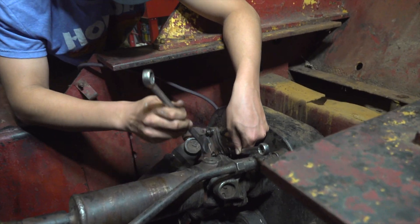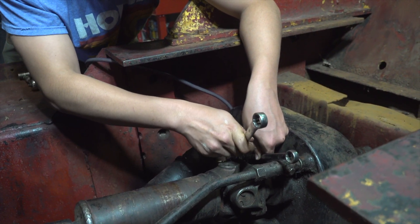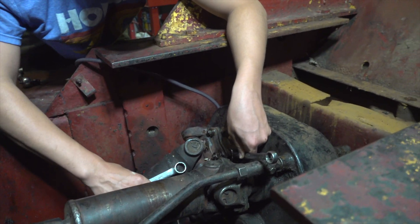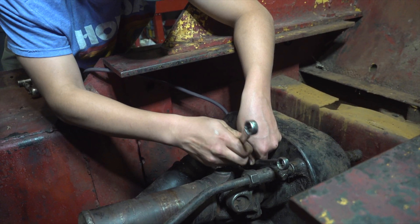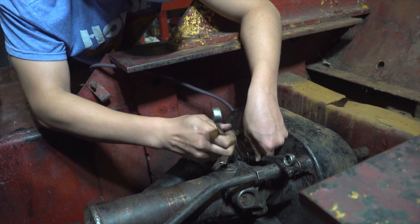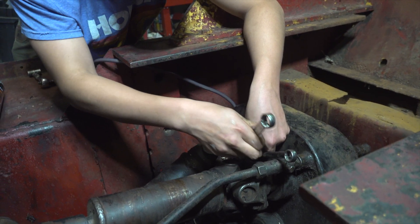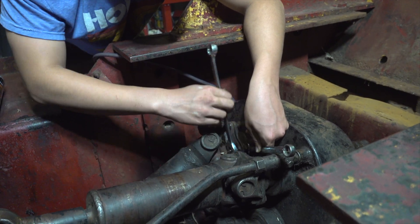Kai's taken out that drive shaft with the bad U-joint in it — real pain in the butt. Looks like they tried to weld the bolts in, or maybe it was original welds, so it's hard to get a wrench on it. The other nuts are just beat.